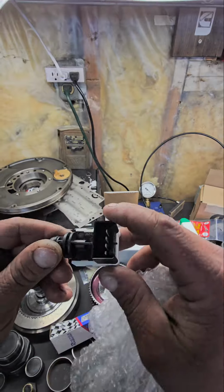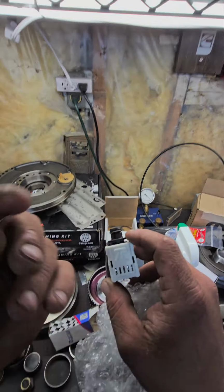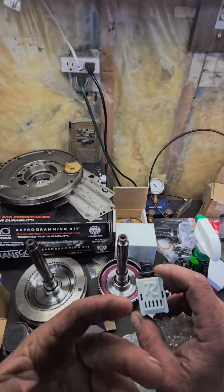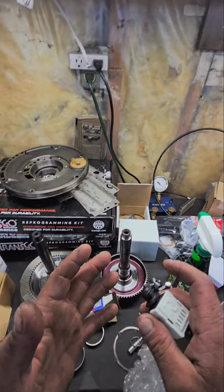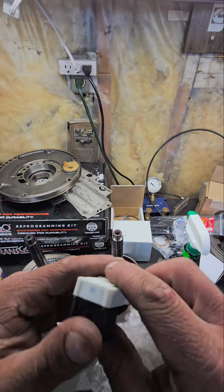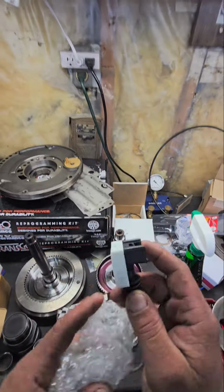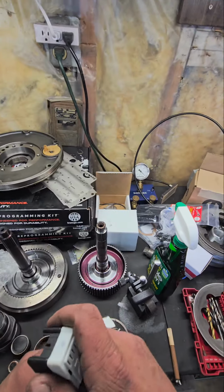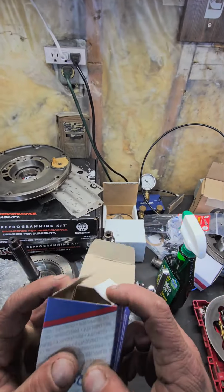This is their newest version of the transducer. The previous high pressure version was rated for 200 psi, and they would still fail. The original version can't handle a high pressure valve body. This version that just recently came out is rated for 500 psi of pressure. So this is basically the end-all-be-all for having electronic issues with your 96 to 07 4-speed.